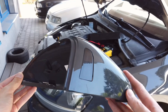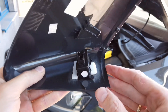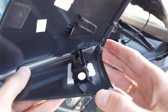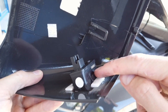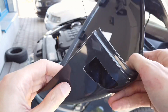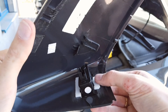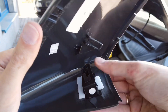Now we are ready to install it back in the vehicle. I've added plastic tabs here which make it possible for the light to clip inside — so I did not use glue to attach the light to the cap. Instead, I made holders so the light snaps into those clips. I've also added some isolation tape to make sure it will be rattle-free, since this is a handmade design and it needs to be held securely.